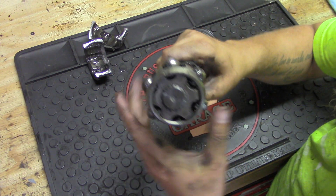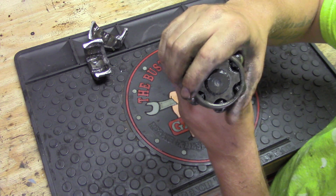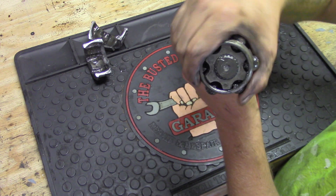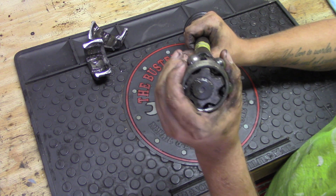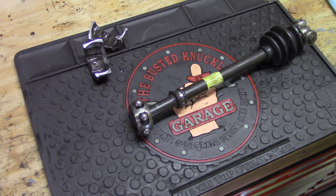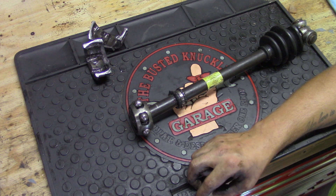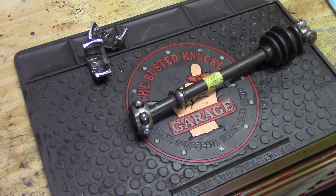We could keep cutting and remove this outer collar that's keeping these bearings in place and get down to what looks like just a gear on that spline shaft — that's the axle shaft itself. That's pretty much all that's going on. So if you hear clicking in your axle shaft, make sure you replace it very soon, because when these guys fall out you're going to lose all kinds of control of the car and it gets very, very dangerous — so be very careful. I hope you liked that video. If you did, please click like, comment, share, and subscribe. I can be found on Twitter and Instagram at Getting Junk Done. Thanks for watching.